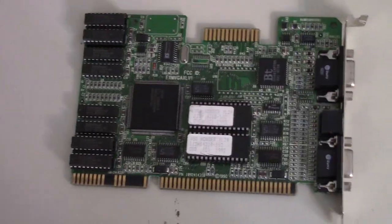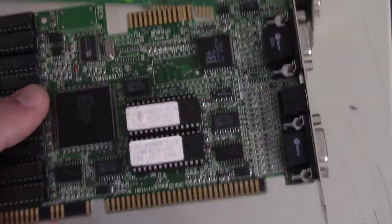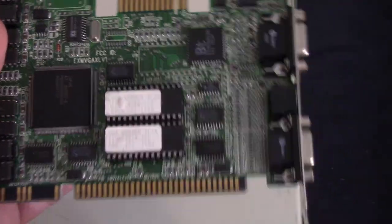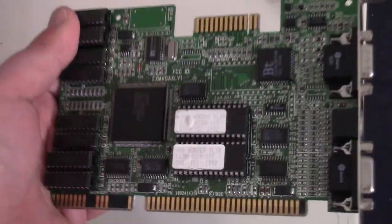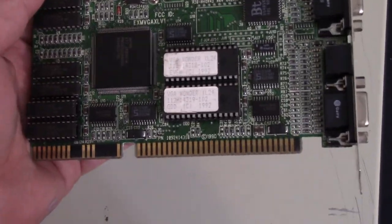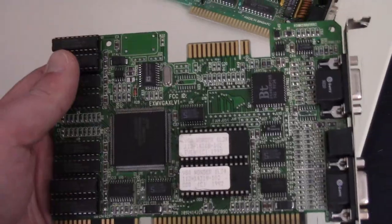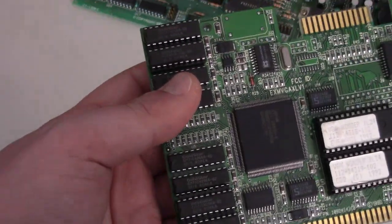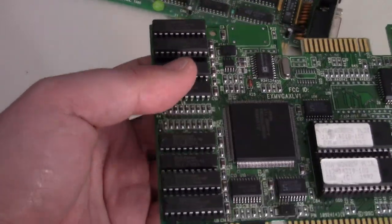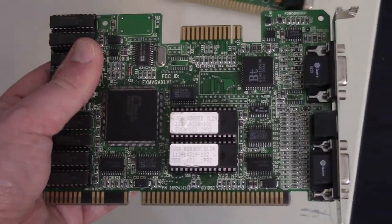And then real quick, let's talk about video and sound. I have not changed up the video card, although I did do some testing with some other cards, but the faster cards I was looking at, I just felt they were better at home in a 386. So I stuck with this guy here. This is from ATI. This is the VGA Wonder XL24, and it does a pretty good job. I believe that's 1 megabyte of video RAM. It might be 512 KB, but I think it's a whole megabyte of video RAM. This card is overkill for anything this machine is going to be playing.